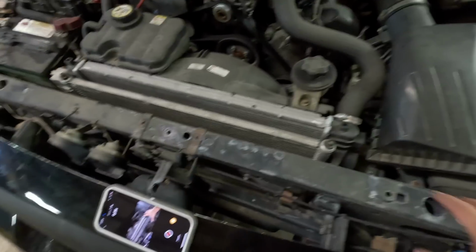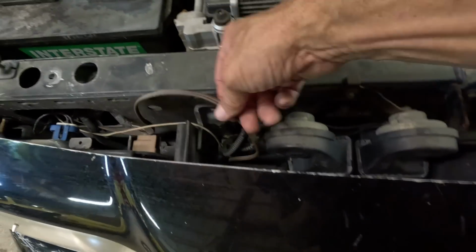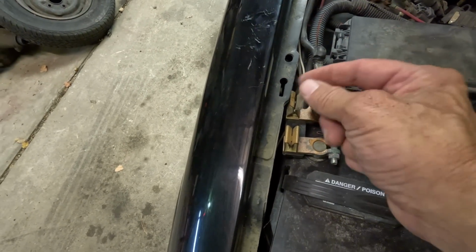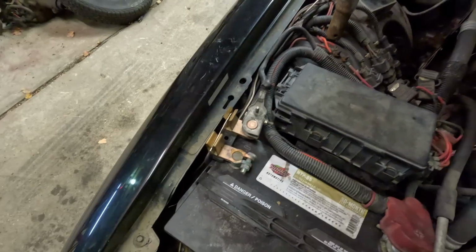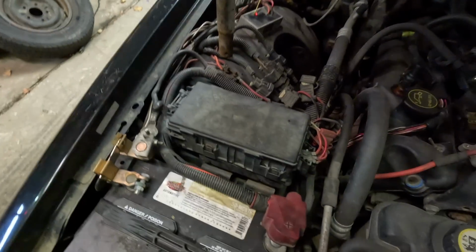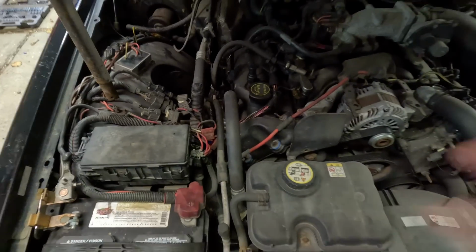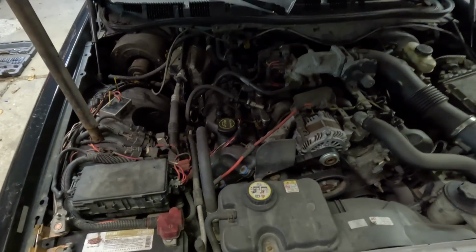I took this plate out right here to look at the wiring, the siren box, and these weird brown wires that almost look like extension cord wires, but I don't think they are. Brown wires underneath the hood of a car always worry me a little bit. So I traced these, and the siren box is still hooked up, so we should be good there. It has this big old toggle switch right here. Not blade switch, I guess that's what you call it. They told me they parked this car for an extended period of time, so they wanted to disconnect the battery, but it just seems a little weird that they put that kind of cheesy thing on there. I got that weird little flashy box right there. I got a bunch of fuses right here that I have checked, and they're all good. These connections all seem to be solid, so I need to find out where the problem is between here and the inside that we're not getting power.